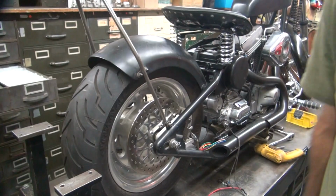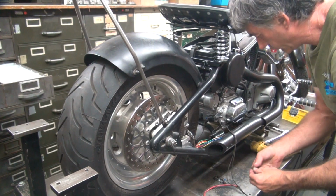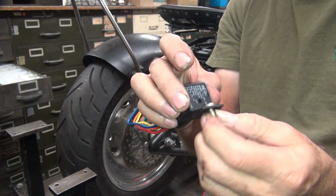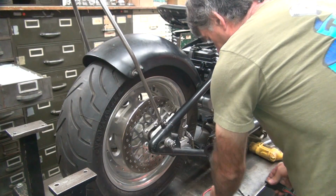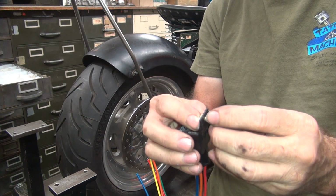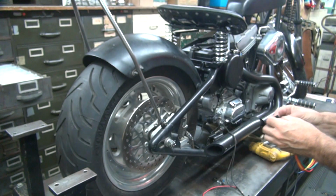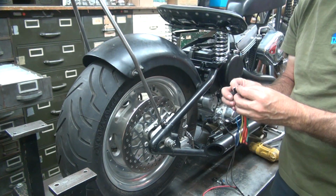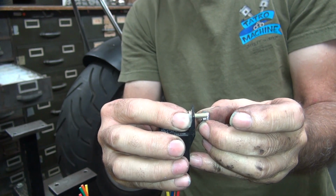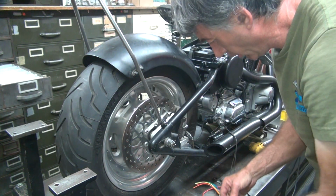That bracket is really thick on that frame. So take our washer, bolt, stick it through like that. Take our nut. It doesn't screw on there for some reason. Looks like it'll be almost a quarter inch thick, and we're done. And I think the bracket is 3/8 of an inch thick, so that means we will not be working on our locking part because it'll be way the hell out here. So this screw is 1/8 inch too short. So we need a longer screw.